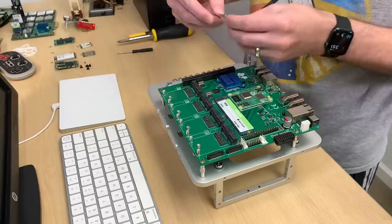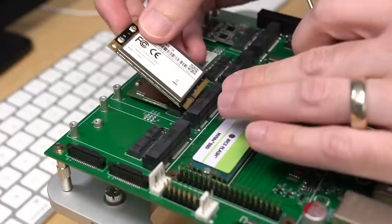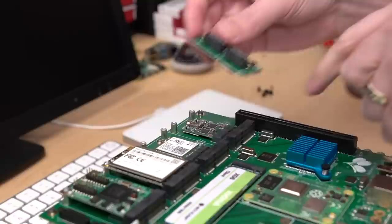I want to see if I can get a few Coral TPUs working — these are great for machine learning, but it'll be an uphill battle because of driver support. I'm also installing a few Wi-Fi cards and this thick Intel i350 mini PCI Express card, which gives me two extra gigabit network ports for routing or connecting to multiple networks. Then I'll install a tiny 2-drive SATA card over one of the TPUs for another SSD — three total terabytes of SSD storage should be plenty.